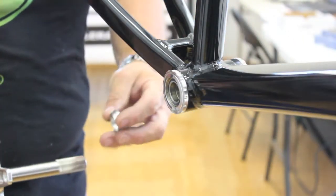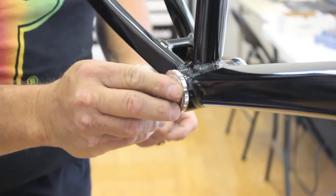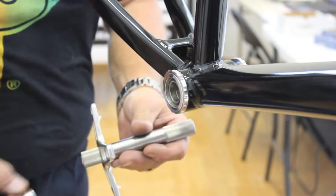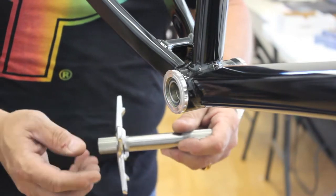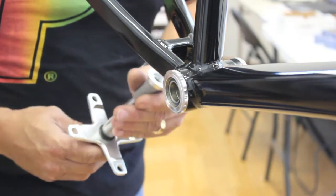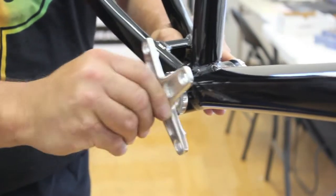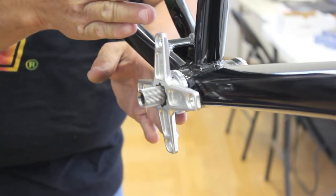The first option: the Euro inboards come with these cones, and the cones go on each side — drive side and non-drive side. If you're using the spline drive spider, as you can tell it's actually dished back over top of the bearing. We'll put this on, insert the spindle, and once your gear is on it will be dished a bit closer to the chain alignment.